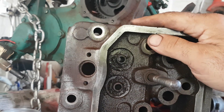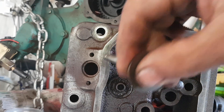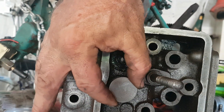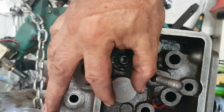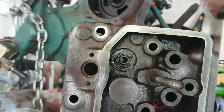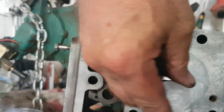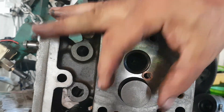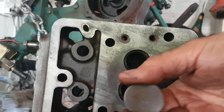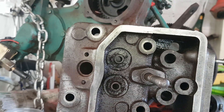One can get an indication of how much wear there was on this engine by inserting it over here and moving it around a little bit. You will see there is a little bit of wear, not too much though. This is now upside down by the way - that's not the way it should go in. Let's turn it around and insert it from this side. It does have a little bit of movement over there, not too much though. My mechanic says it's fine - he's got many many years of knowledge on these things.